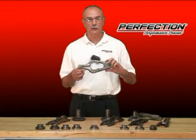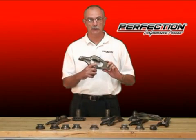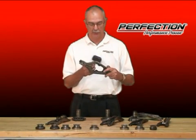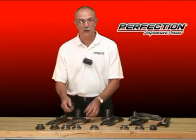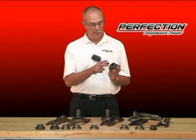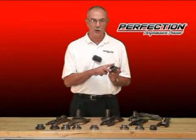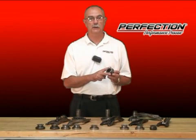This one's for an S10. You can see we've got a different style fork, but we've got the same relationship and the same potential to make a mistake. Spring tabs are on the back side here. Now, if you thought GM was the only place this could happen, this bearing belongs to a Ford Mustang. You can put it wrong on that fork also. We don't see it as commonly, but it can be done.